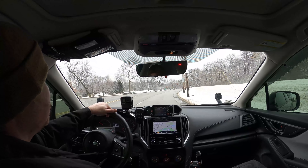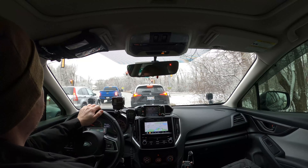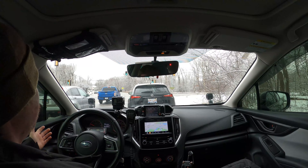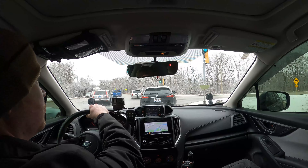So, how does it feel now with the rear sway bar links disconnected? Driving around town on blacktop — mostly you're driving straight lines anyway — I hardly notice it. Going around turns, I do notice a little bit more body roll. We'll take some turns here in a second as we make our way to the highway, but it's nothing I would say really compromises performance, especially when you're talking about taking turns at a normal speed in the city. Now, if you're planning on drifting around corners and driving like a nut, then yeah, you might notice a bigger difference. But for me, day-to-day driving, so far so good.